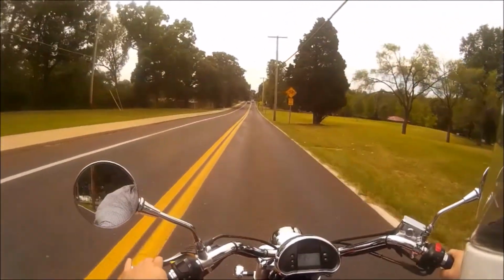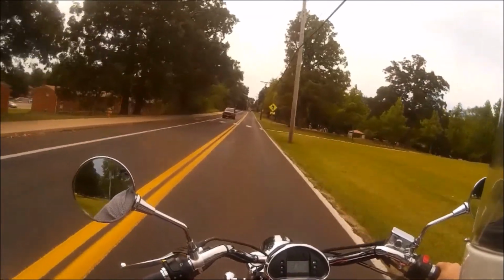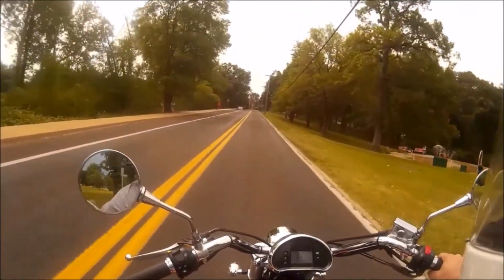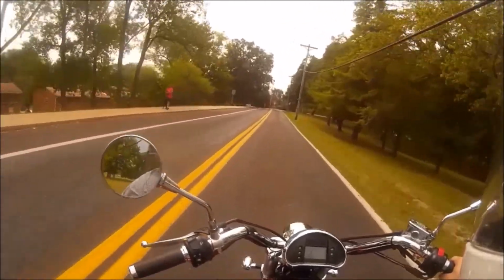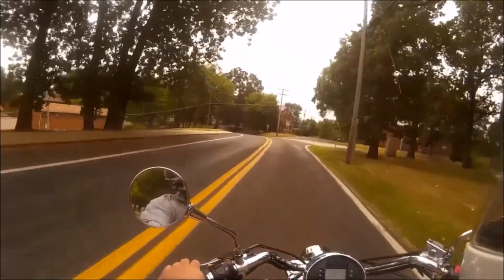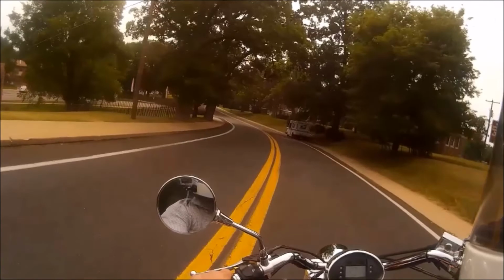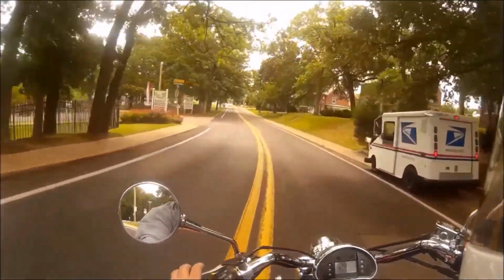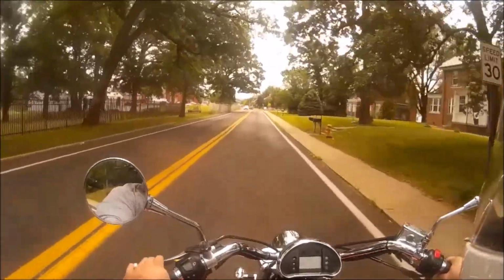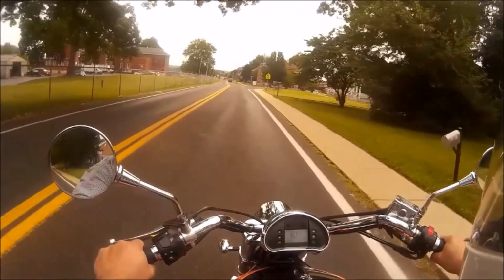But anyway, what's really popular right now is what he did years ago to this bike. He put a Ninja 250 stator into it, and he put a MOSFET regulator into it and wired it up. That's something they should have addressed years ago. The bikes are pretty nice, but there are guys that are still having problems with them. But that's pretty much mainly the only issue.